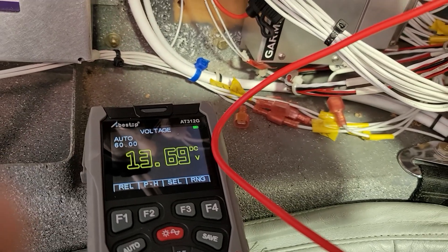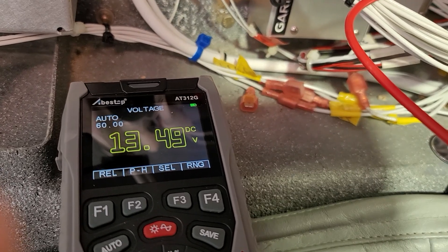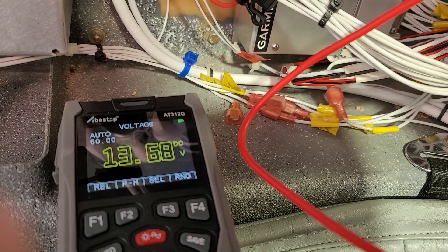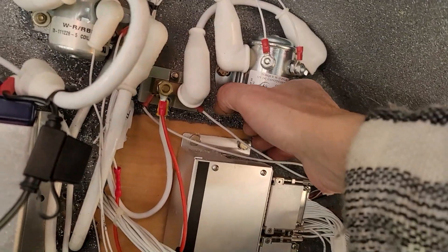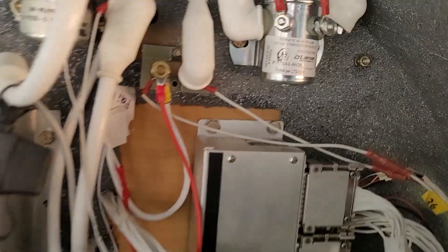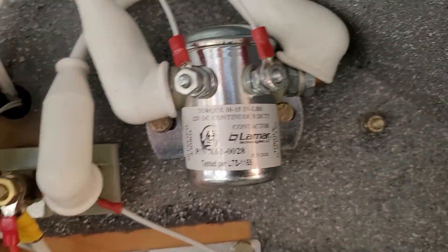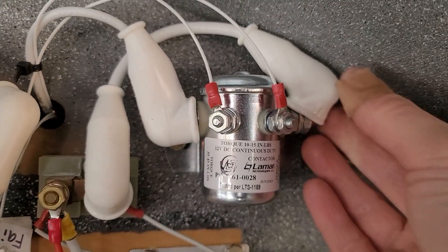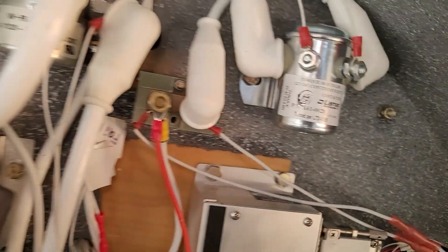13.7 on the left side of the alternator solenoid. On the output of the alternator solenoid I've got 13.5, so I'm losing 0.15 volts just through this little solenoid right here, which is definitely warming up. That is my alternator shutoff solenoid. That contactor is rated for 100 amps continuous. I'm drawing only 10 amps through it, and I'm dropping 0.2 volts. So that's a problem right there.